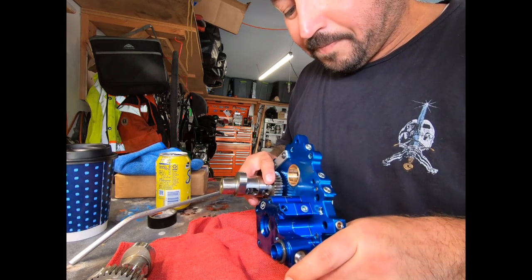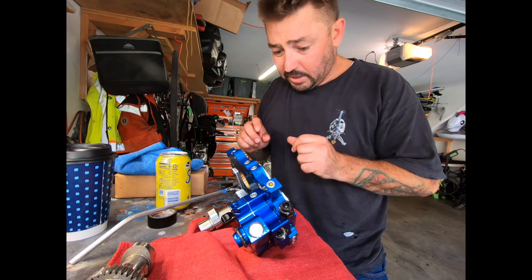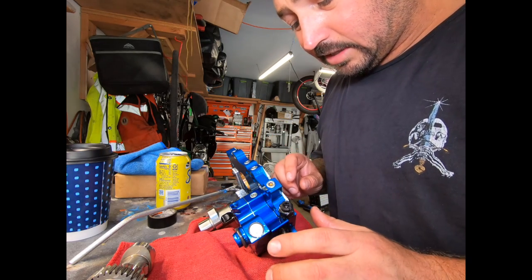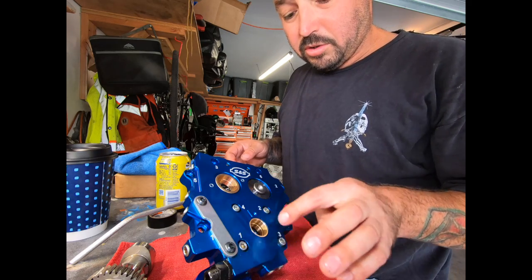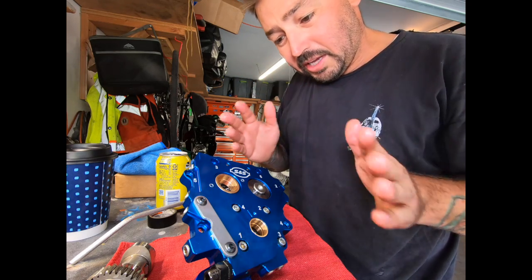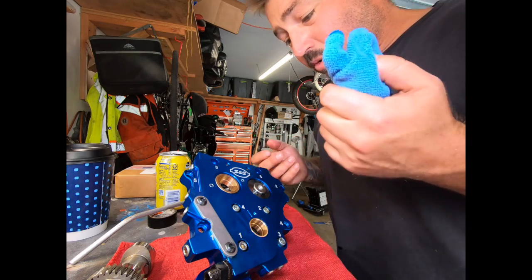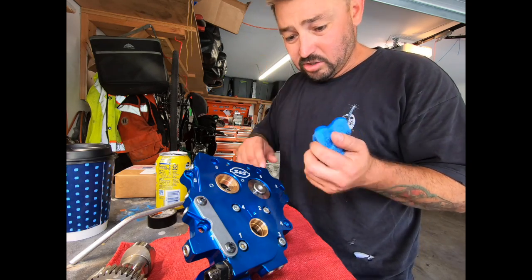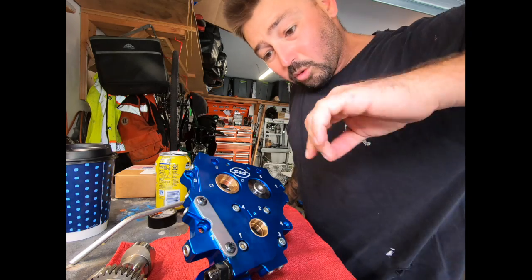So we're gonna remove it, then we're gonna put our oil pump into its slot, right? We're gonna put it in there with the O-ring. We're gonna shove it in there. Then when we put our cams and stuff inside of there and we start to bolt the oil pump up, we're gonna go 1, 2, 3, 4, but we're just gonna barely get it to where the face of the oil pump is touching the plate. You can go and read in the manual, but we're just barely gonna get it bolted up. Then we're gonna grab my rotor, turn the engine, pistons going up and down, turn the engine. Then we're gonna go 1, 2, 3, 4. I'll probably do one full turn.